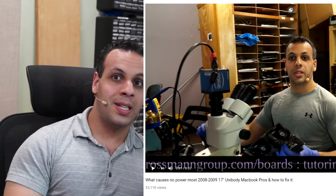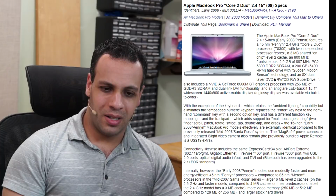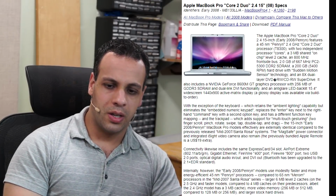If you go back to 2008, now we're just getting really long in the tooth, and the 15-inch ones from that year had all sorts of issues with the graphics chips failing, the screen frames coming apart, and the A1278s from that year actually don't have bad hard drive cables, but again, you're never going to find a good battery for it, so don't do it.